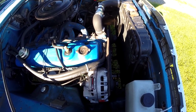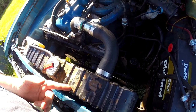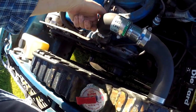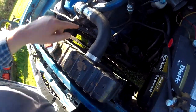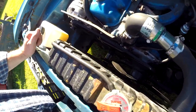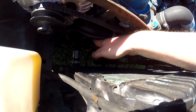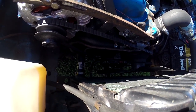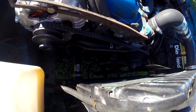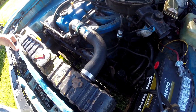This is a Chrysler radiator but it's not the original one — the original had the outlet on the other side, so it's really just a right-angle bend to get to the water neck. This radiator is off some other Chrysler, so I had to make up a custom hose. The exact hose doesn't really exist, so I put two hoses together. The bottom one came out right and has a really funky bend in it to avoid getting eaten up by the fan.